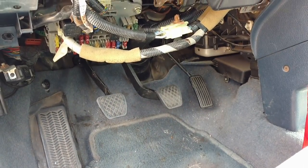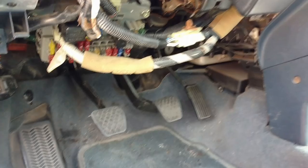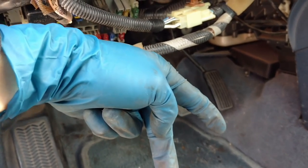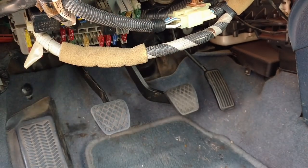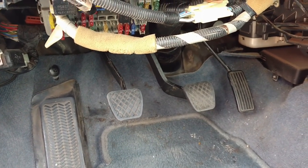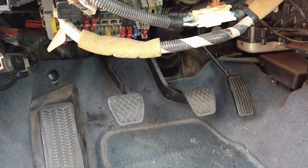The reinstallation was just the reversal - it's really not as difficult. The hardest part is sliding the gas pedal back around the steering column and getting it in there, but other than that it was a straightforward process and it is working perfectly again. Hope this helped you guys out, thanks for watching.